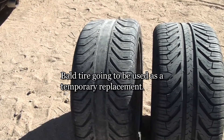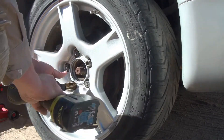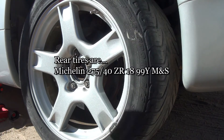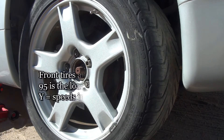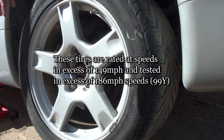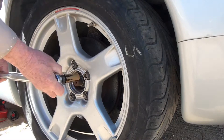Time to put the tire back on. They require 100 foot pounds of torque — I'm going to do that when the tire's on the ground. What I found out about these run-flat tires is you can run for 200 miles at 55 miles an hour when they're flat, but then you'd have to replace the tire. The fronts are smaller than the back and they're designed not to be interchanged front to back, or even switched from side to side. The speed rating is right up there over a hundred and some miles an hour.